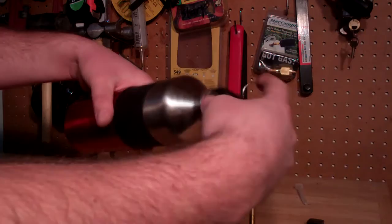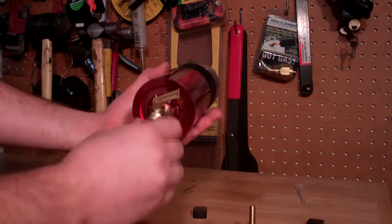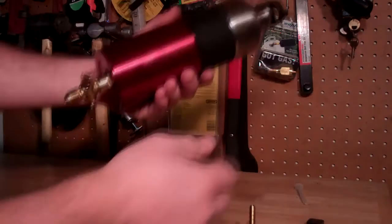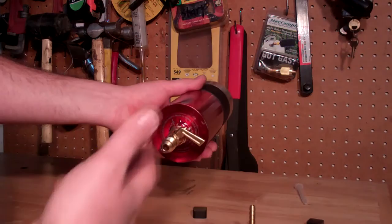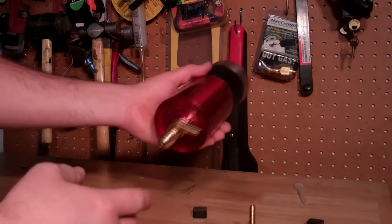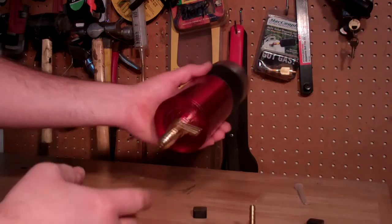That's pretty much it — it's a pretty simple deal. Use your imagination; this is just the idea I came up with, but you can make this out of different things. Motion Pro sells one that has a nice hanger on it. I use these bottles because you can put a carabiner or a piece of coat hanger through the loop and hang it up, making tuning your bike without the tank on a lot easier. On some street bikes and ATVs, that's a real benefit because the carburetors are already hard to get to. This will make it easier since you can work without the bodywork or tank on there. Until next time, I'm the Junk Man — thanks for watching.